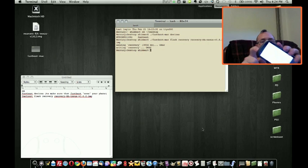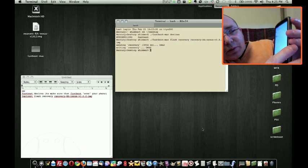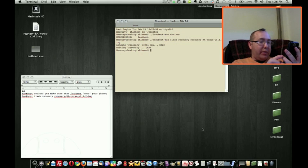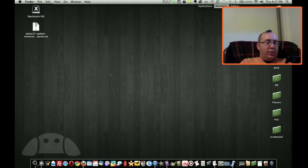From the bootloader I'm going to use the volume key to go down to power down and select that, so the phone just turns off. To boot into recovery mode, hold down the volume key, press power, keep holding down the volume down key. It runs through a couple things and I can use the volume key to go into recovery mode and press power. Now I have this new recovery image installed, which will make it easier to flash ROMs. I'm going to go to backup restore, hit the trackball, and do a NAND backup because I want to backup the stock Nexus One ROM. Create an Android backup — press trackball to confirm. Performing backup. Backup is complete. Now I'll reboot the system.